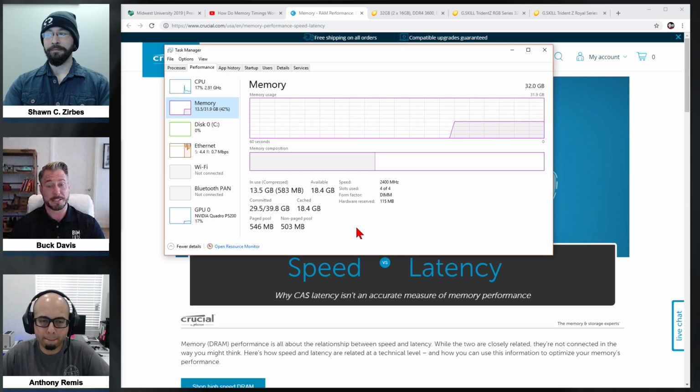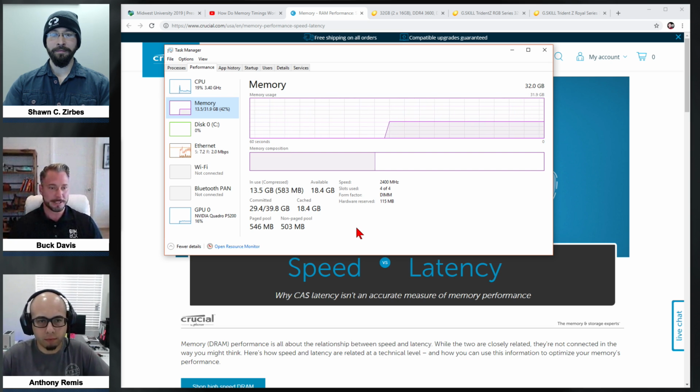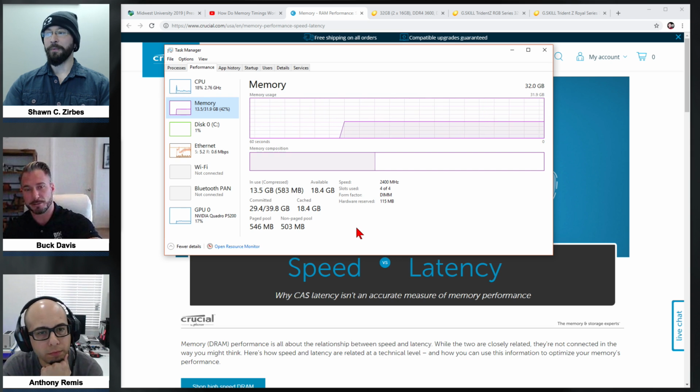So 32 gigabytes, if this is all you're doing, and I know people get scared, they're like, well, it's 29, man, I should just get 64. If you have everything under the sun open at 29, you're probably pretty safe at 32. I know Anthony might disagree with that, but if it's going to be another $1,000 to give you just peace of mind on RAM. Right here, actually, you're only using 13.5 gigabytes. Excuse me, I was looking at the wrong line. In use, 13.5, available 18. 32 gigs is enough for you.